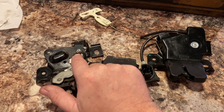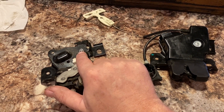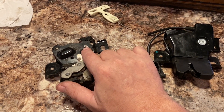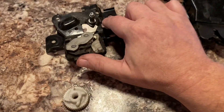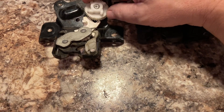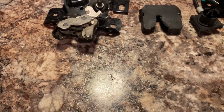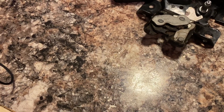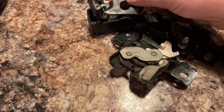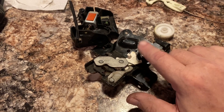I've got an idea of how to make this work. Basically this holds it together. This spindle was peened over to make like a rivet head, which I ground off. So I'm thinking of just drilling all the way through on the drill press and putting a bolt through there. I need this diameter part here - it guides this lever to center it. So I need to retain that, and like I said it holds it together. We'll see in later videos if it works.